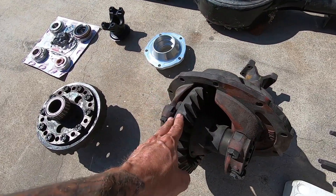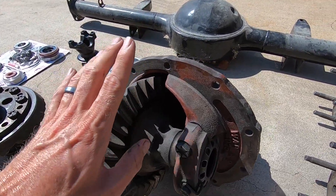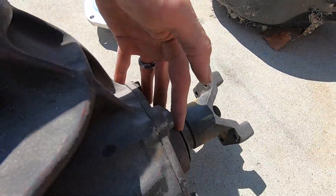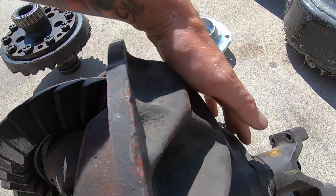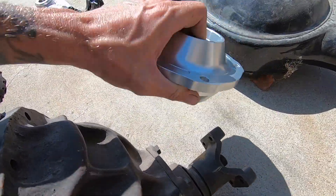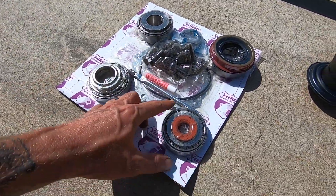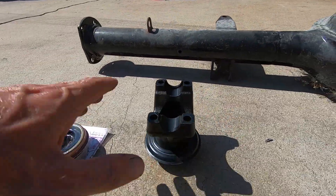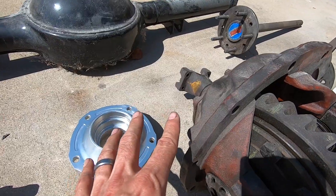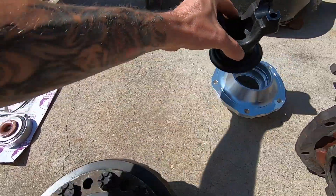Then I needed gears because I debated running what I already had, but I think it's just too high. And the other thing I wanted to do to help this thing live is a Daytona bearing. This is a larger bearing that your pinion rides on in here, and there's a lot of stress between these two gears. From what I hear, this is what busts and breaks on a weaker case like this. So this will help negate that. This is the carrier portion that will go in here, and that supports the larger bearing. This is a shim and bearing kit so I can set everything up — got the new nut and all that fun stuff. We also have to go with a new yoke because I have a 1350 U-joint going in versus the 1310, which is a standard one. This is a forged piece, much stronger, and this should survive the shock of the trans brake.